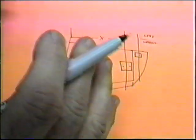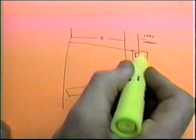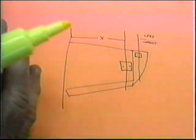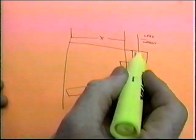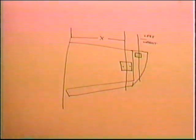So there's always some little angles, and my angle has always been, in these cases, to get the tip weight box, and I think we've done it as far forward, because planes typically don't come out nose heavy as often, and this one sure isn't, as often as they come out tail heavy. So having the weight forward and as far out in the tip instead of further back, that can save you time too. Just a couple of things relating to tips, because that's the part of the job. And all through the course of the videos, when a thought goes through my mind, something that people might be able to use, I like to include it on the video.